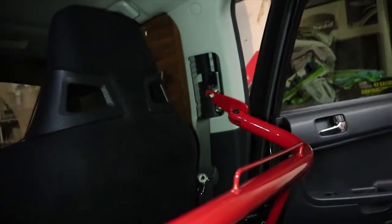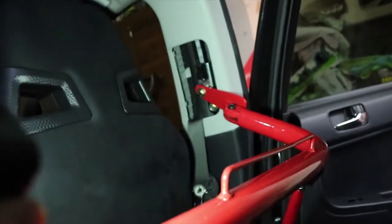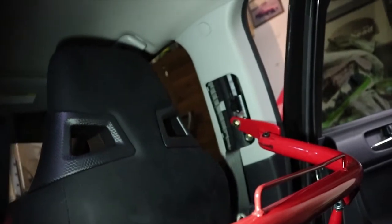The bar's in. It's fairly easy to do the top ones and pretty self-explanatory — just put the bolt through that top seat belt mount. I don't do anything with this side because I don't use my normal seat belt, but I leave it up since there's no harness over there yet. I need to make this side's post a little longer and fix that top mount — it's a little too straight for the mounting. Other than that, it's fairly easy.